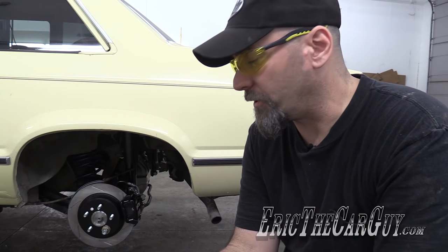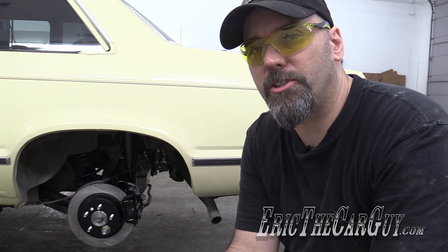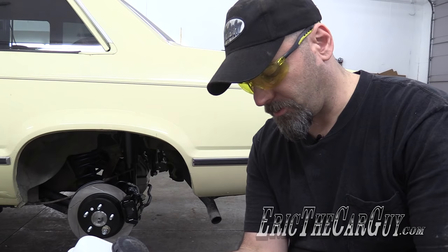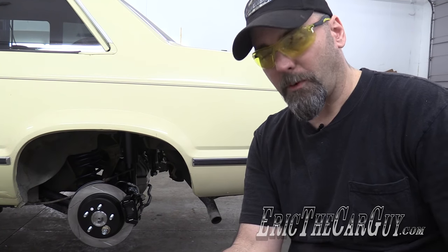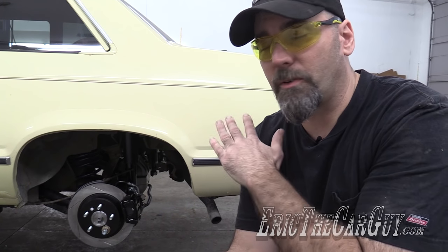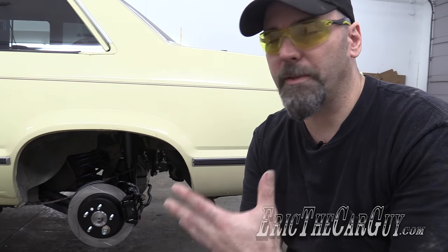Off-camera, Brian and I ran a whole bottle of brake fluid through the entire system and there's no air coming out back here yet. The brake pedal is pretty much junk. There's some more stuff that I need to install - that would be this trick proportioning valve and also a new master cylinder. There's also this funky brake line that goes along with it - a proportioning valve bypass. It appears that I cannot find any leaks, so it seems I've got to finish installing the rest of the braking system in order to get a brake pedal.